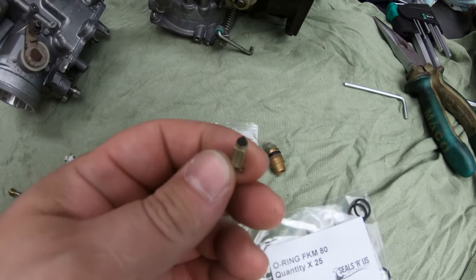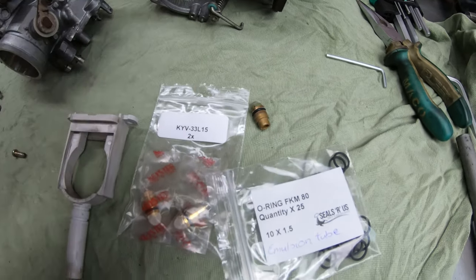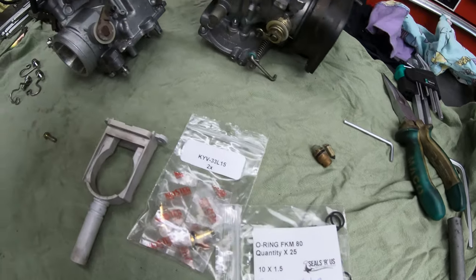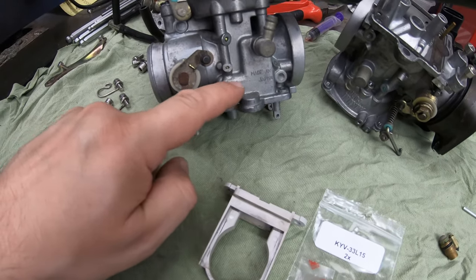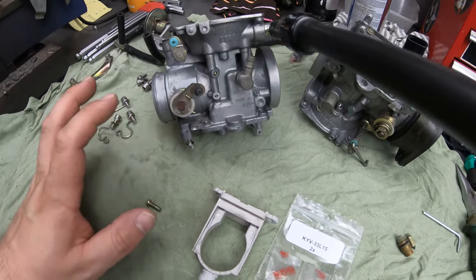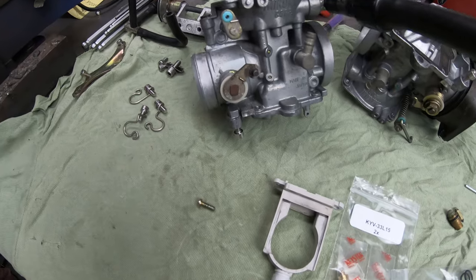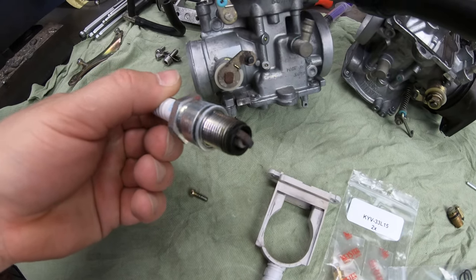I will try to make some macro photos of this to see the line. I think that's why it started leaking slightly - very small leak - and the fuel level became too high. It was about here, and basically it was just dripping petrol into the carburettor and it was way too rich, as you can see on my spark plug. The front is bang on - that is beautiful, absolutely perfect.